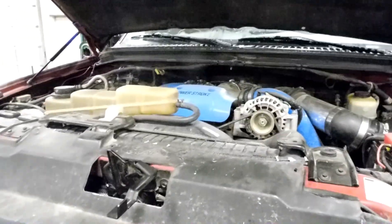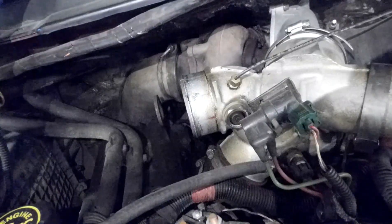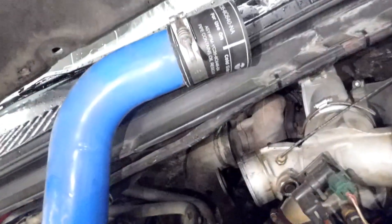So that gives us a rough idea what it sounds like. Now to install those two. What I've done is took off the intercooler piping — push that one up out of the way because we need to get back to that bolt there, and then there's one right back there. Pop those out and pop on your new HPX line, and it's as easy as that. Then change the fuel pressure spring underneath this cap — take off that nut there for the fuel line, pop off the two allen bolts, and change out the internals.